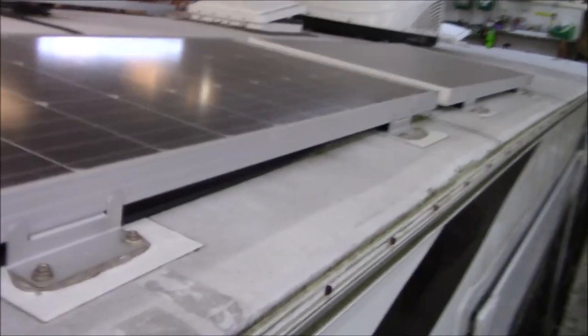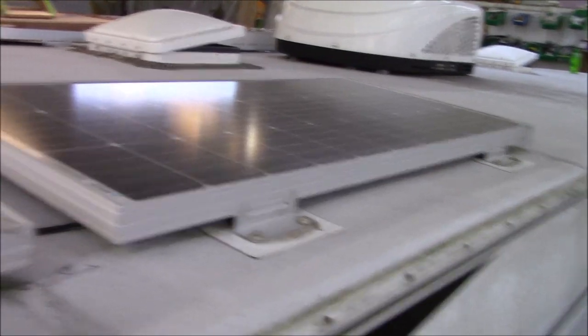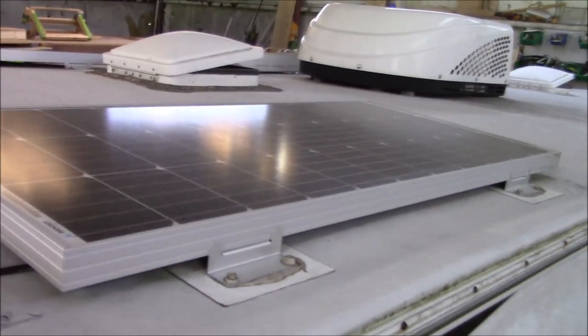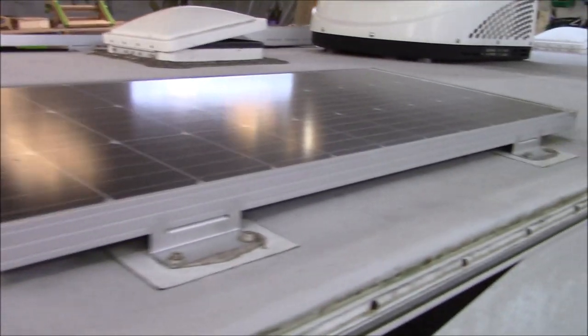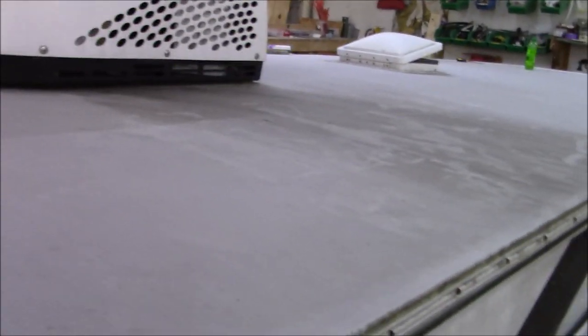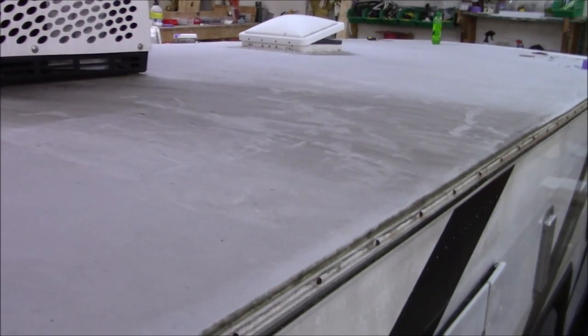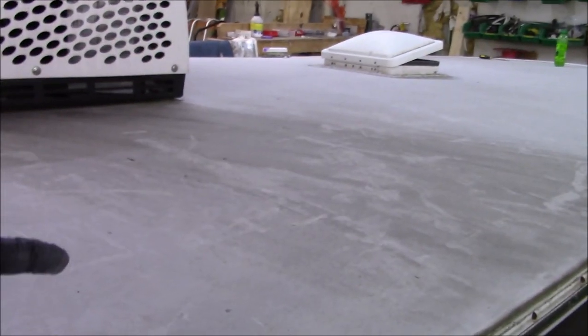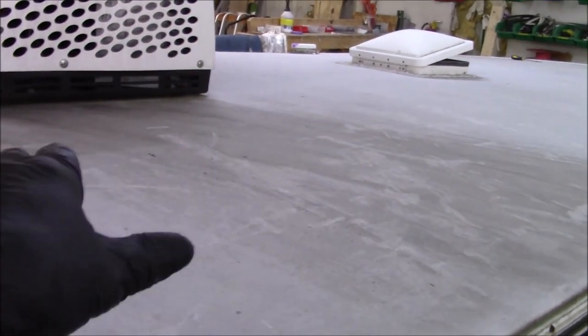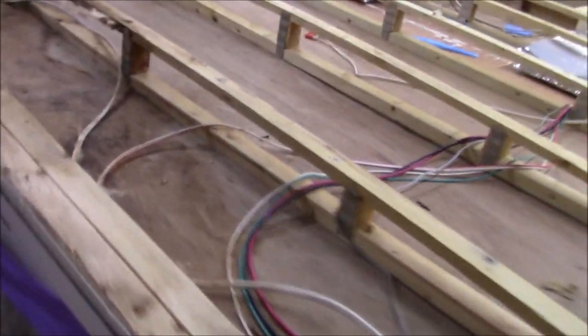We're gonna tear the decking off. We're tearing everything out. If this is the first time you're watching the videos, we're gonna end up checking all the trunk lines. We check the electrical, check the trusses, check everything up underneath this thing to make sure everything is all set before we just commit to putting a roof on it and find out that the tape they used on the trunk lines was failing. Or a lot of times they'll run wires over the trunk line, and just from the movement, it starts to create a hole in the trunk line, and now all that cold air is coming up in between the trusses. So we check all this stuff. We'll show you when we open it up. All right, this is our voltage.